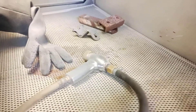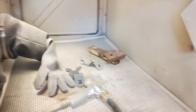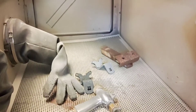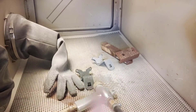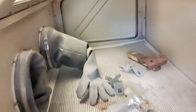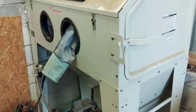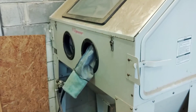It's got a really good light up at the top so you can see well. One of the brackets is already in there — we're gonna put the other one in. Whenever you put something in a sandblasting cabinet, think about where your gloves are and where your gun is, and once you get the gloves on, how far you can reach. You don't want to put it way over in the corner and not be able to reach it. It's a simple tip but it helps out.